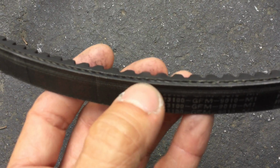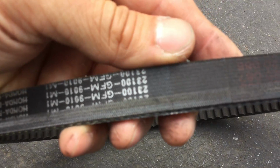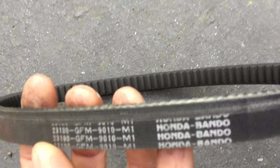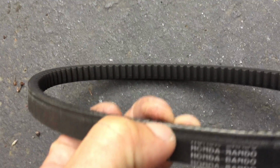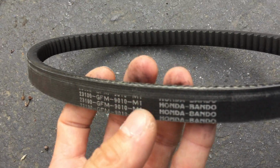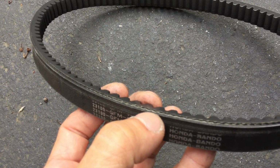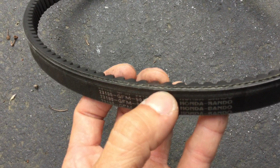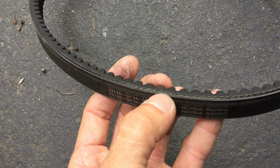So you see the groove there that formed. That's because I have the shaved variator boss with a washer behind the variator backing plate. So the belt would ride higher and give it more taller gearing. But it rides so high that it actually touches the pinion gear.